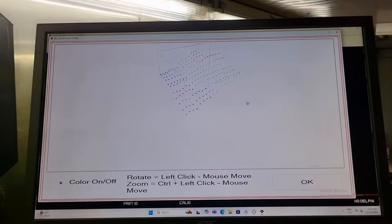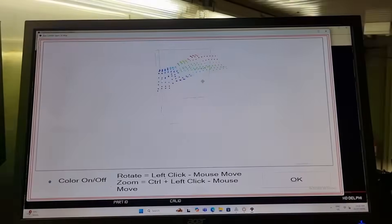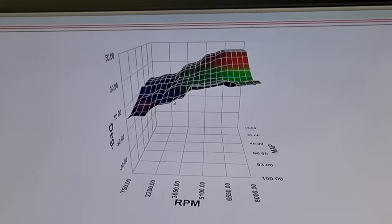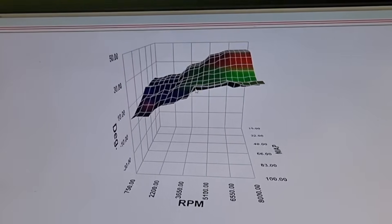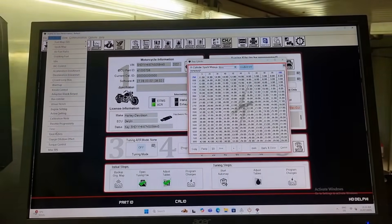There's not much going on here — this is going to probably feel very flat through the roll-on. We want to lift this section up, tidy it up, blend it all in. It's going to take a little bit of work, but hopefully with some time on the dyno here we'll get this thing looking right. It shouldn't be stepped up that much — we should have a nice ramp as it comes on. Anyway, we'll keep going and have a look at a few other things.